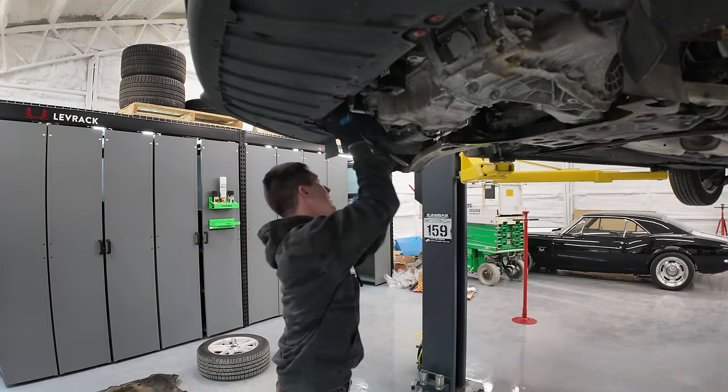As all of you Ford techs just saw, I got slowed down quite a bit on the wheels because, of course, the lug nuts had swollen. All the lug nuts on this were trash, so of course I'll need 10 more lug nuts when we're putting it back together. The Ford caps, if you've ever worked on them, they swell and you end up banging the socket on with a sledgehammer, and luckily the way to do it is to not unscrew it all the way and then work the socket back off.